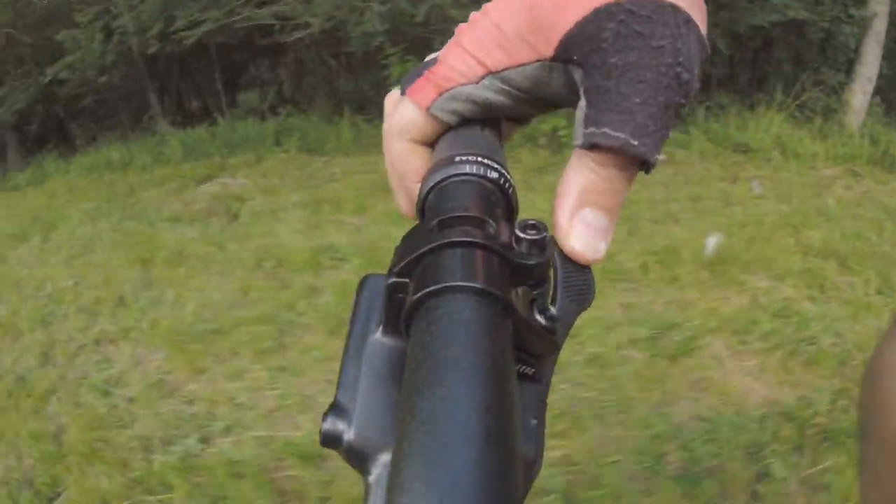9-speed with this range is perfect. I did not hear chain slap whatsoever on the trail, even on the jumps. Now, for shifting: you gotta use your thumb — there are two levers. To shift to the lower gears, the higher cogs, you can go three or four at a time. But to shift down to the smallest cogs you go one by one, thumb only — no index finger shifting. That's a drawback, but it's super fast, super responsive, and I highly recommend it. Box, if you want to sponsor this channel, feel free — I actually like your products.